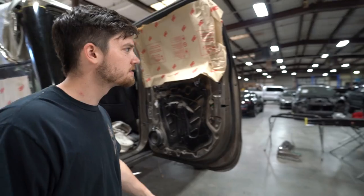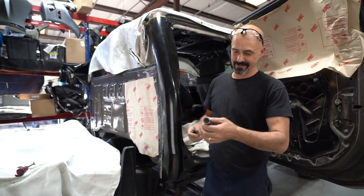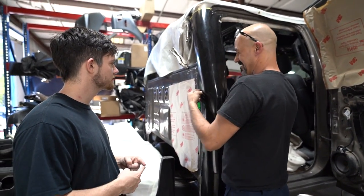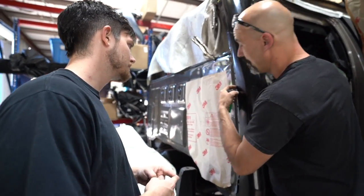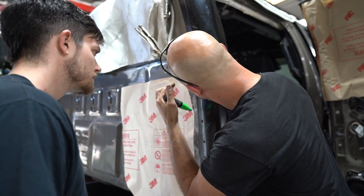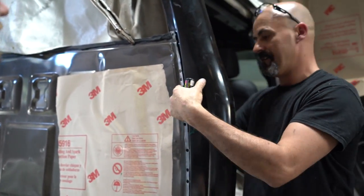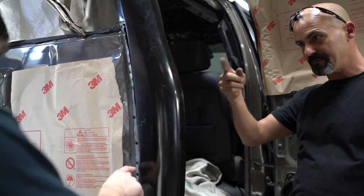Even I understand it. I also am going to show you how to cheat real quick, because I'm pretty good at this. I like cheating. Funny thing is your fingers always know where they're at, right? Yeah. So you can reach in here, and your fingers always know where they're at. So that hole right there, we don't want to drill through, because there's nothing behind it. We need to put a hole right there, so we can get penetration into that single tab that was behind there.